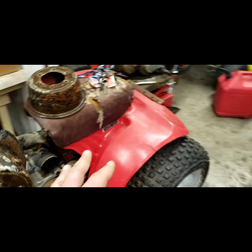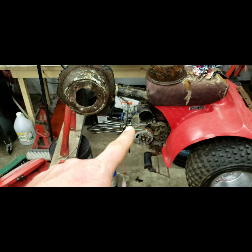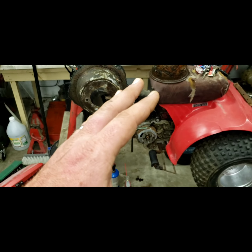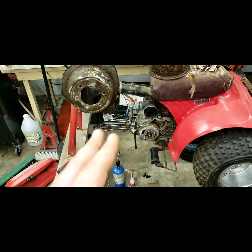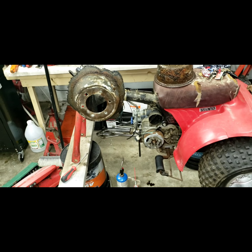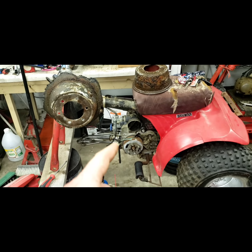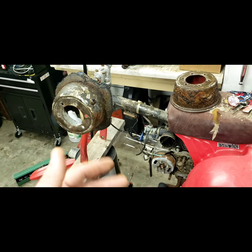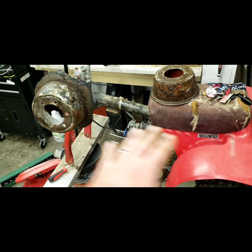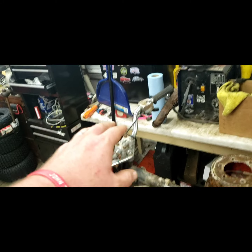I'm going to use most of the parts on this one. I'm going to go ahead and order new rings for this one, probably going to hone the cylinder, make it look pretty — I think it'll clean up real good. I know in the last video we kind of scuffed it up a little bit, but I think it'll be alright. We're going to take this off, check the points and everything in there, hopefully it's good. Put the new coil on it, see if she's got spark. We're going to clean all this up, detail it, paint the frame, polish the chrome, try to find a kill switch.